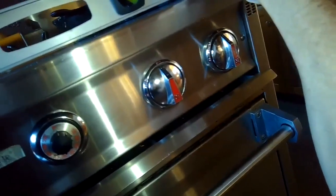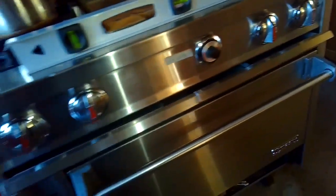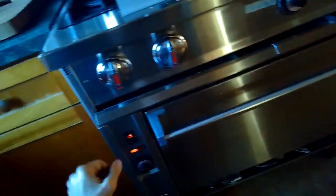And if you don't have it level, when you're frying eggs and stuff, everything goes to one side of the frying pan, so it's better if it's level. And it's pretty easy to do. Just need adjustable pliers, like slip joint pliers. Channel locks would be great. And I'm going to do a little bit by hand here just to get it started.